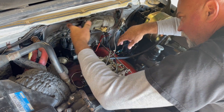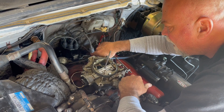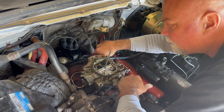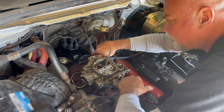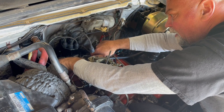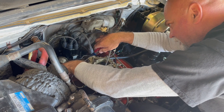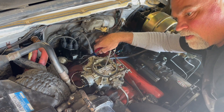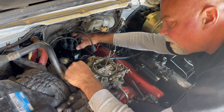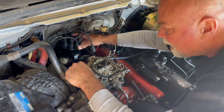There is a bolt that comes down here that tightens the bracket, which keeps the distributor from moving and in place. We're going to loosen that bolt and also remove this vacuum advance hose — pull that off to get it out of the way. They make a special tool for this, but you can do it with a wrench; I've always done it with a wrench and it works just fine. I crack it loose and set the wrench to the side. You'll notice the distributor is now loose. You might want to take note of its general position — you will have to retime the car, but you want a good starting point.